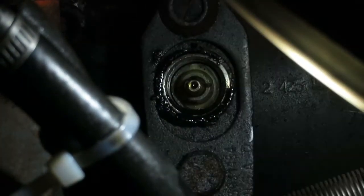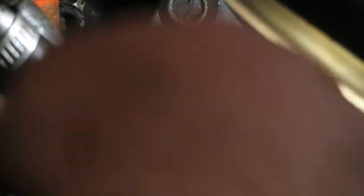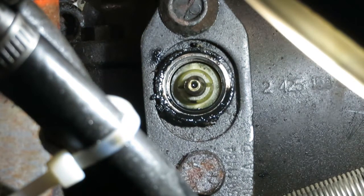A way to make sure you have it actually on there is to take a pair of pliers and try to wiggle it back and forth — twist it. If it won't twist, then you know you have it on the tab. Once you have the pump pin timed, you want to crack the nut off the injection pump again.